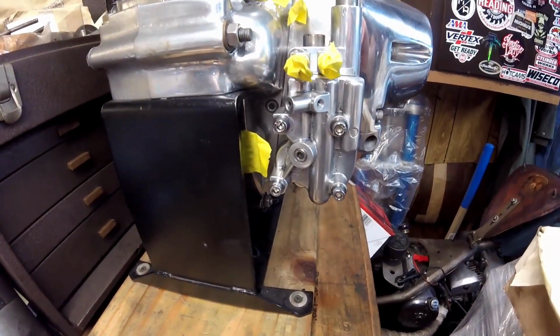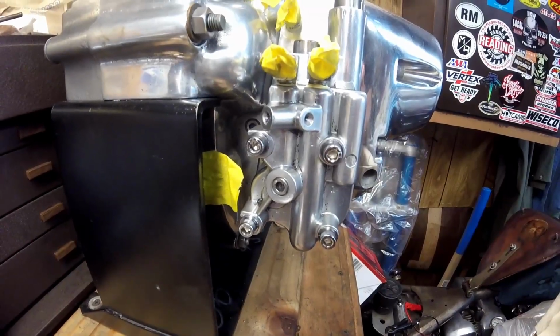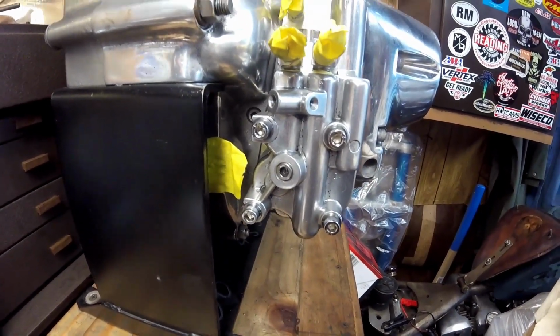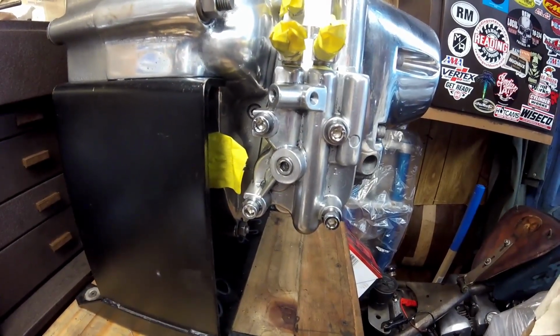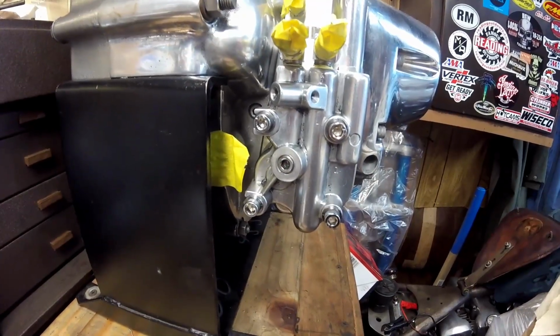I was recently asked by someone all the way from Italy, the question is, there are oil lights coming on and off, and how would be the best way to check that? You can definitely have a bad oil pressure switch, and that'll bring your light on, or you can have an intermittent short in your wiring to ground, and that'll bring your light on.